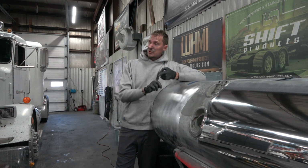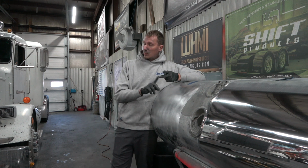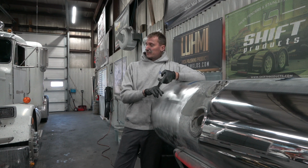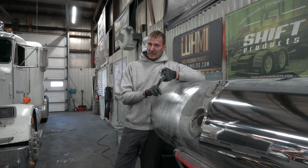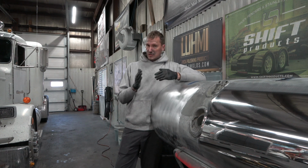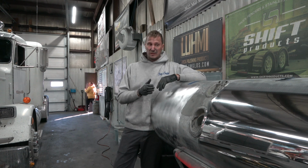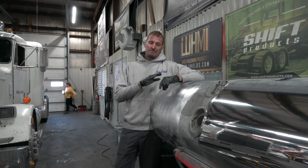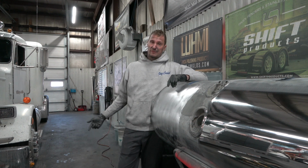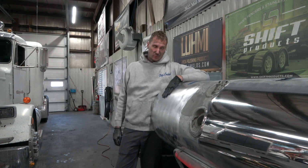Two steps of orange and brown, our regular brown. A step of yellow, well, we clean with aluminum polish in between the orange and brown and the yellow and brown. And then we clean after the yellow and regular brown, and we go with a white untreated and a show brown. So we clean in between those three steps, and then we clean one more time after the show brown, really super light, and then we take most of the hand polish off with just a terry towel, and then we go into our show green, and then from show green we go to another softer white flannel with a purple compound just to get rid of the last little bit of hash marks.